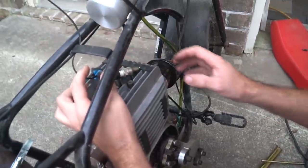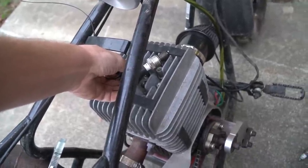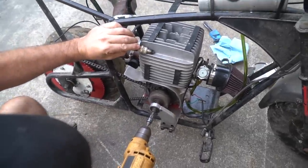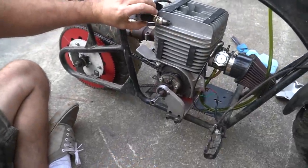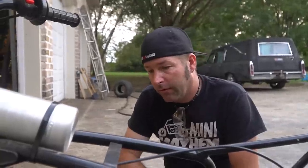The original spark plug looks like it might be iridium. We tried a known good plug and got nothing. The coil gap has been adjusted down. It looks like there are really only two things that can go wrong: the coil and the CDI module on the side of the block. We feel like we need to get both. We're stuck — we can't finish this without new parts. We swapped the axle, mounted the KT100, rigged the exhaust, and got right to the finish line — just no spark. No bueno.